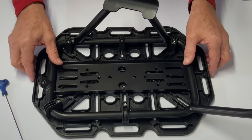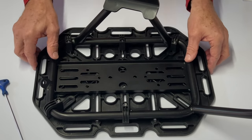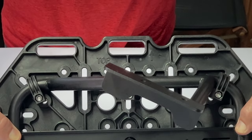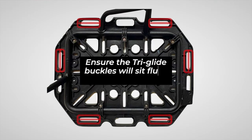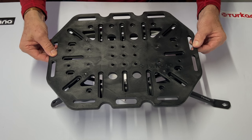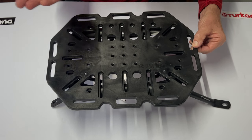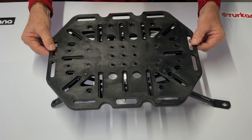For the purpose of this video we've done this off the actual motorbike, but the process is identical. Just remember when attaching it to the motorbike, the plate does have an arrow and the words 'top' — please orientate the plate upwards. The only exceptions to mounting this luggage plate would be the BMW 1200 liquid-cooled, the 1250, as well as the BMW 850, as they have stepped racks. Brackets are in manufacture to allow ease of fitment on the exhaust side.